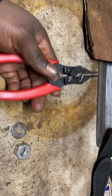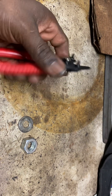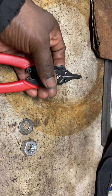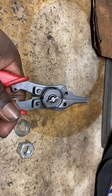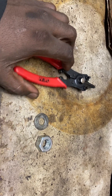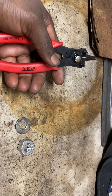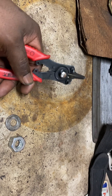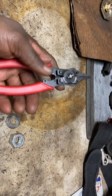For the circlips you need to use snap ring pliers. These don't do bad — I think I got these from Advance. It has a switchable head where you can push and lock, then flip them around whether they need to open or close. Definitely going to need these, unless you can pick them with a little screwdriver, but that's probably going to be more of a pain.